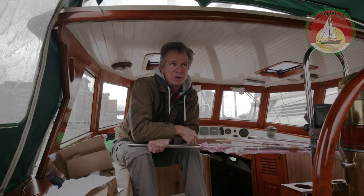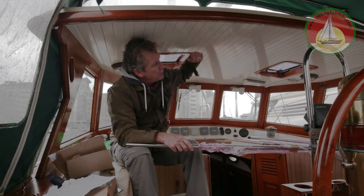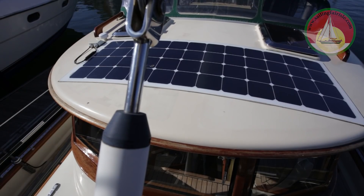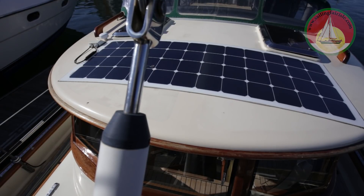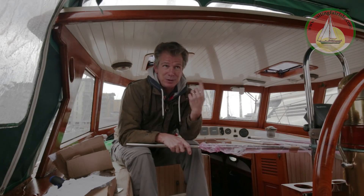I'm lucky to get half that. I've got high hopes for these ones because they're glass panels and they've got virtually no shading from there. The one we've got at the moment is 150 watts on top of the doghouse — a flexible panel. We don't get much out of that at all. It's 150 watts and you'd expect about 13–14 amps on paper; you'd be lucky to get half. We get about a quarter because we're 51 degrees north and mainly because it gets substantial shading from the boom.